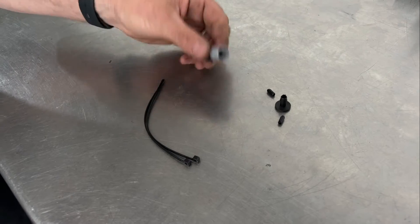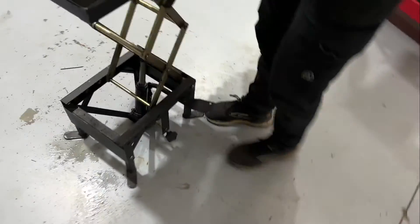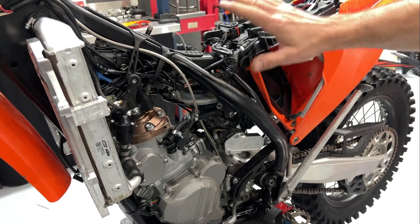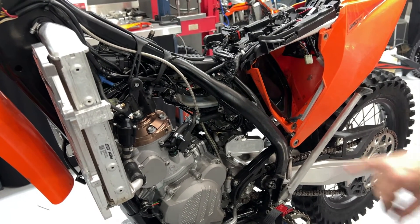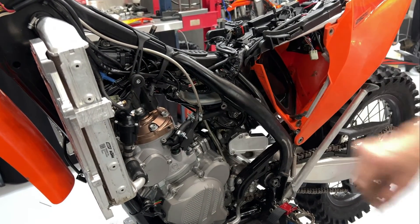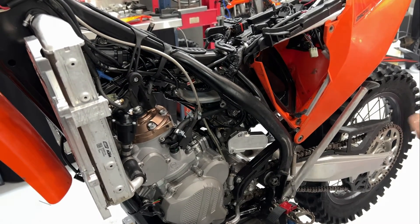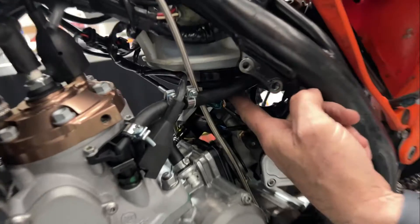So let's go over to the bike and install the connector first. On this bike I've already got the tank and seat removed. I've also got the chassis mount removed, which isn't totally necessary but it does make this video slightly easier to see. The oil pump is found up under the oil tank — you can see that's the oil pump right there with the blue connector connected to it.